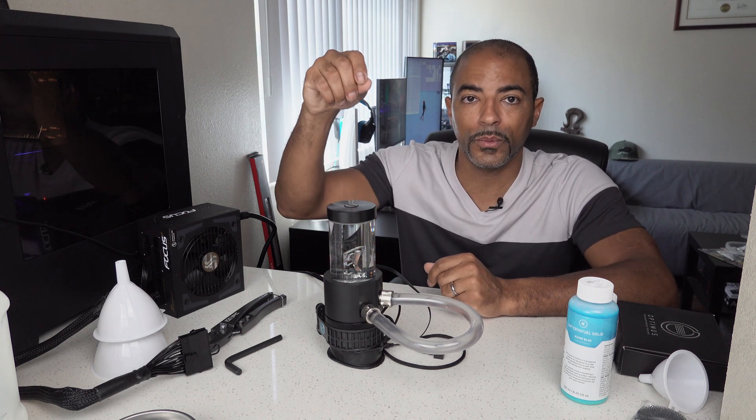So I'm going to call this a success — it doesn't look like this pump has any issues whatsoever. I'm going to go ahead and drain it, and basically all I'm going to do is just open the top and dump it in the sink — it's very simple. When you are building your own custom water-cooled PC, you have to make sure that you have a drain port. That is a common mistake new people into water cooling get into: they're excited, they build their loop, they can easily fill it because most pumps have a fill port, but you actually have to plan out your drain port. With Deep Blue, all I have to do is attach a tube to the drain port, turn a little dial, and the system starts to drain. When it stops, you open the top valve of the fill port to let air in, and the rest of the fluid comes out. Make sure your drain port is installed at the lowest point of the entire system — let gravity do the work for you.